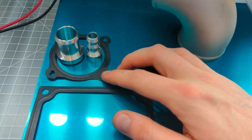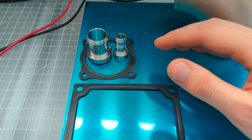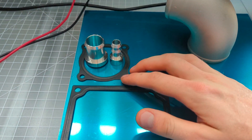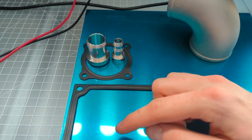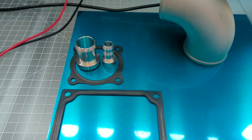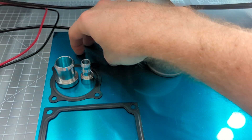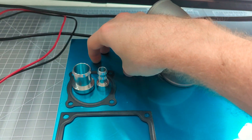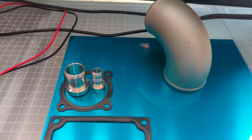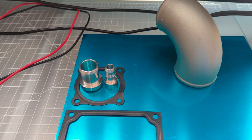This smaller one is the diverter opening, where the factory diverter valve — which looks a bit like a throttle body — is basically a bypass to allow the supercharger to send air in a circle. There's a separate opening which is the inlet itself, coming from the air filter, and that's also where I'm going to put the MAF sensor, just between the filter and the non-boosted side of the supercharger.